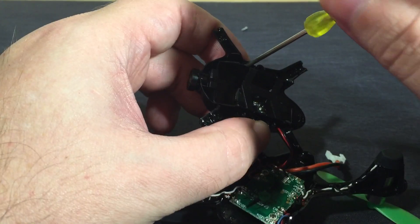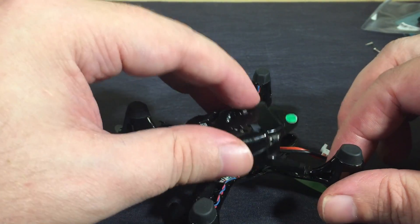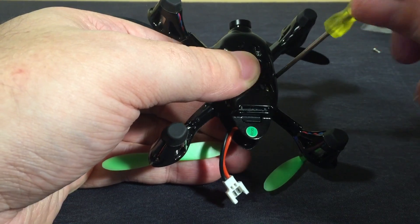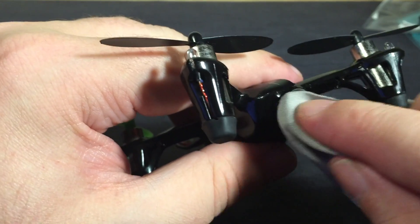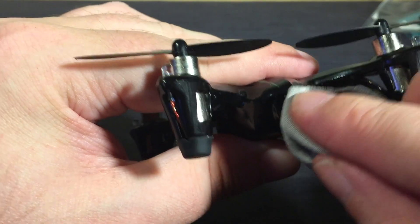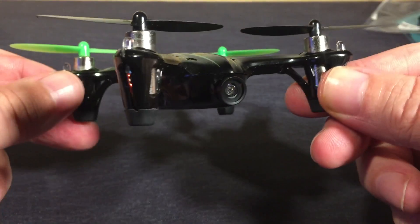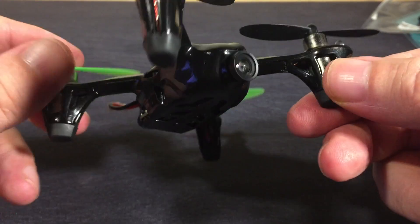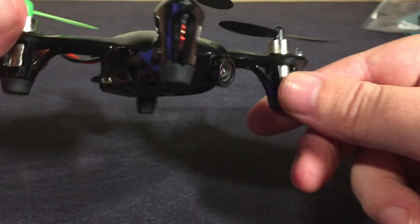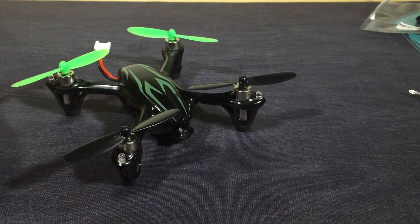You will need to use a bit of testing and trial and error to screw and unscrew the lens to achieve proper focus. An easy way to do this is to mark the lens barrel on one side so you have a frame of reference for how far it's been turned. Then take short clips in different positions, check the footage and see if the focus is correct. If not, rinse and repeat. Once you've locked in focus, it would be a good idea to apply a little bit of hot glue or other adhesive to lock the lens in place, because it will twist back out of focus quite easily.